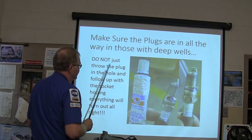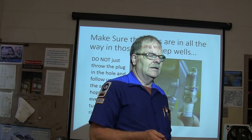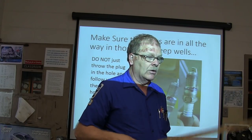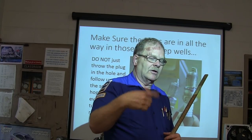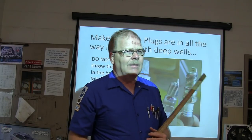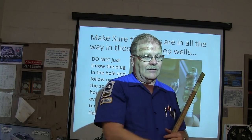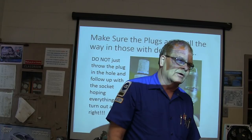Make sure the plugs are all the way in when you're going into those deep wells. We had a 6.8-liter V10 Ford van that blew a spark plug out of the hole. You're working up under the doghouse way up in there. What we do is turn the engine over and blow air into the throttle body until it's coming out the spark plug hole. Then we get our 14-millimeter, 1.25-thread tap. The threads aren't damaged badly enough to need a helicoil, but you can't get the plug to screw back in because the threads are just slightly damaged. You want to run that tap down in there and clean it all out. If you're working in the backyard without an air compressor to blow out the filings, put a whole bunch of grease on the tap — the filings get caught in the grease.